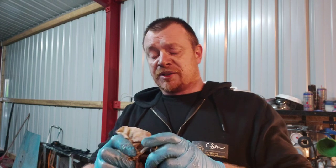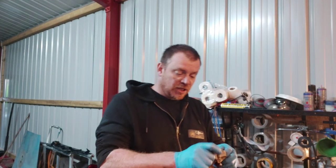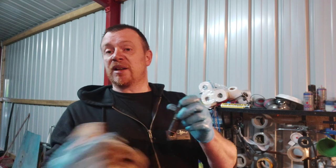These are out of a two-and-a-quarter diesel. These are all mechanical injectors — it's the same principle for most of them. PD injectors are getting a hell of a lot more complicated, but these are just old style, driven off a mechanical pump.